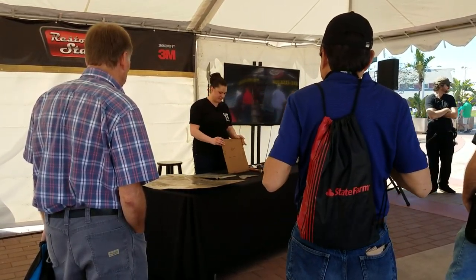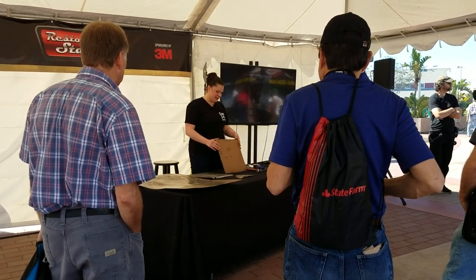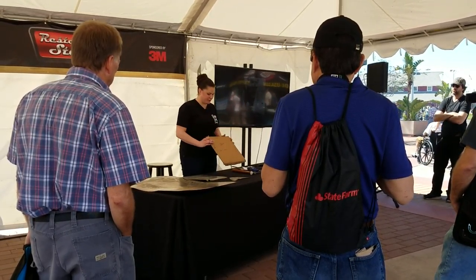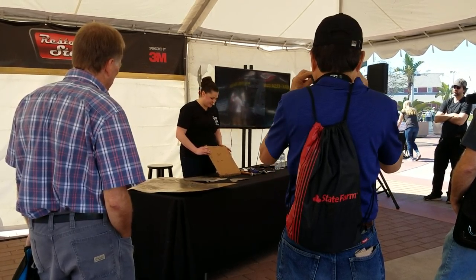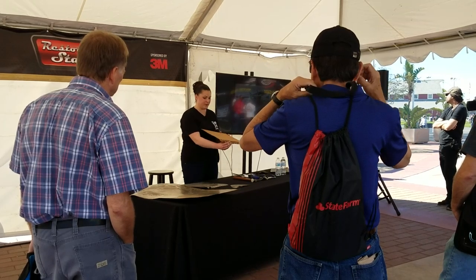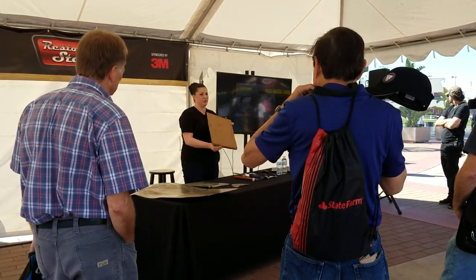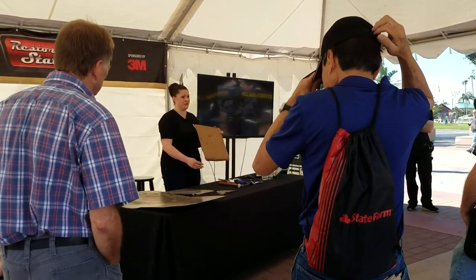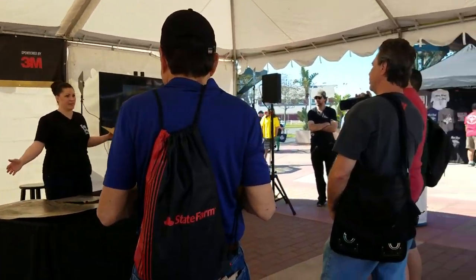So then you'll come back and make a template. This was for a fender patch on a Monte Carlo — it's just roughed out, but it did fit the area I was going to repair. I just wanted to give you an example of what material you could use. You could use parchment paper, even tracing paper, something thinner if you're making a really big panel with a big contour.